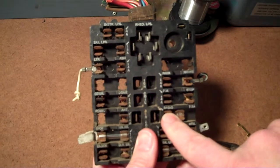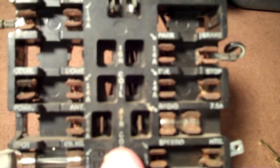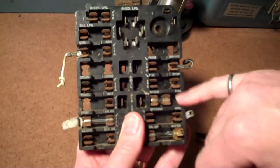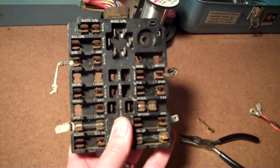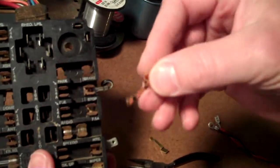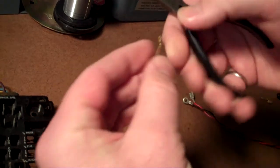I like people to use the radio circuit fuse whenever possible because it's cleaner power. Getting this adapter on this fuse is difficult — it's a narrower space and it's an aggressive spring situation. So instead of worrying about that, use this other adapter. What we're going to do is modify it a little bit — this little J right here, we're going to cut that off.